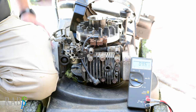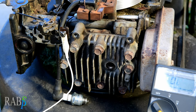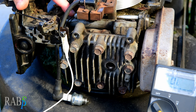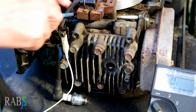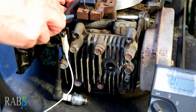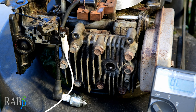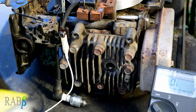Right, we're all set. Now, the kill switch is our first concern — is this wire shorted to ground? There's a simple way to test that without getting all convoluted with a multimeter, and that is to just unplug the coil from the kill switch like that.